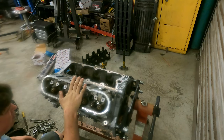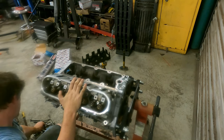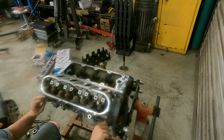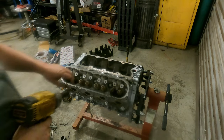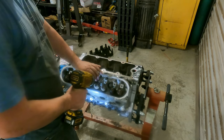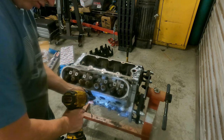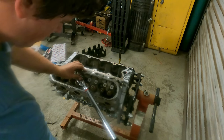Reach down and grab a couple bolts. After two bolts are in, it's over. All right. Now, I'll bring you back in just a second, because I forgot to get all my tools ready. All right, so now we're just going to pull all the bolts up, set the gun to minimal power. All right, so now we're going to torque these heads on, 22 foot-pounds.